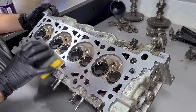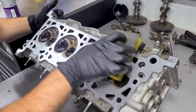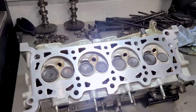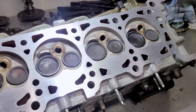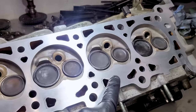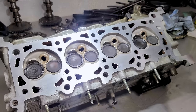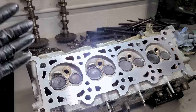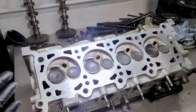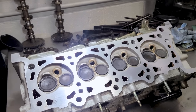After going at this quite a few times — trying to get it as shiny and clean as possible, keeping it well lubricated — I think we are done. We went from this all the way to this. If you wanted to remove the staining from the head gasket you'd pretty much have to get this milled, but as long as the cylinder head is perfectly smooth and within tolerance with the straight edge, you can save that money and don't have to send it to a machine shop. Let's check the surface for warpage with our straight edge.